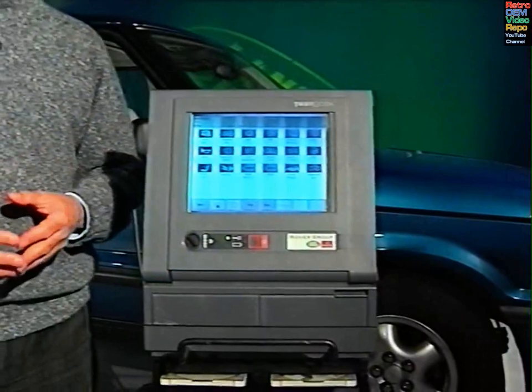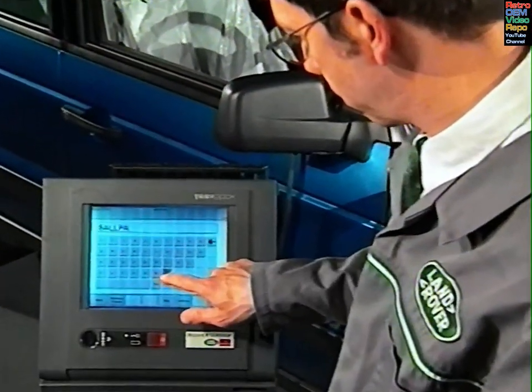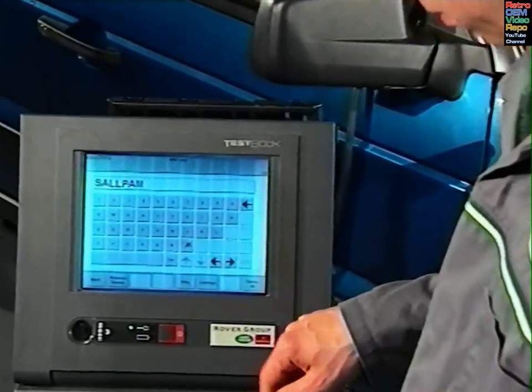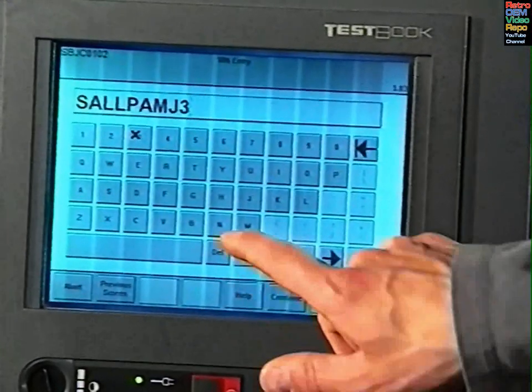The majority of configuring is concerned with the vehicle's security system, and in some respects is similar to the individual systems fitted to other models. The difference being that, once again, everything resides within the BeCM, rather than in a separate security ECU. The security side of the BeCM requires 4 items of data. First, the vehicle identification number.